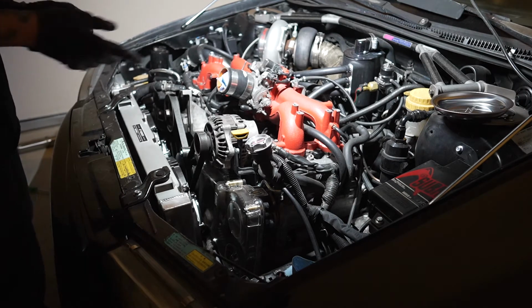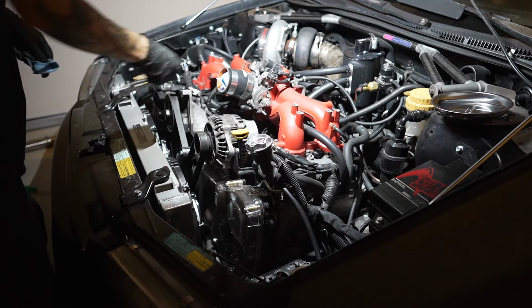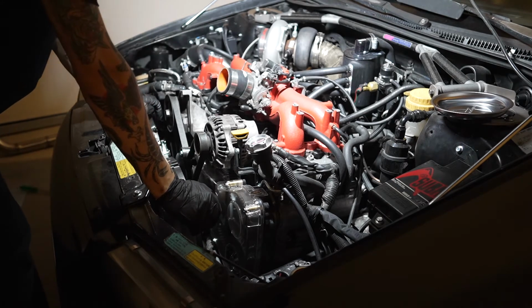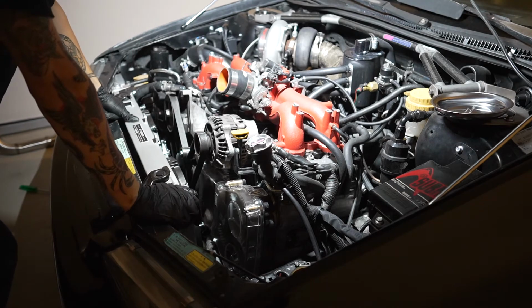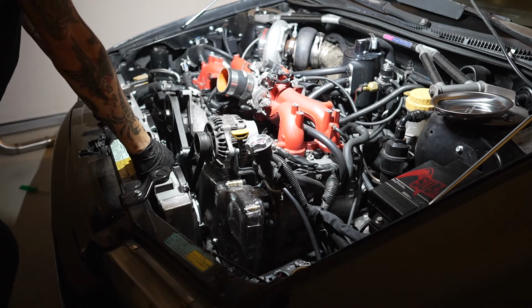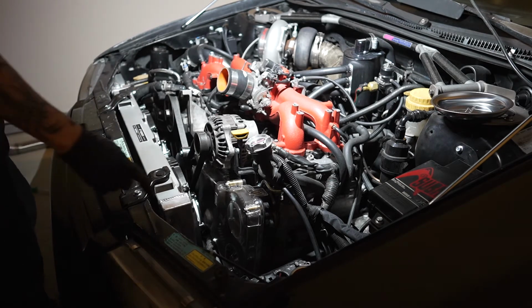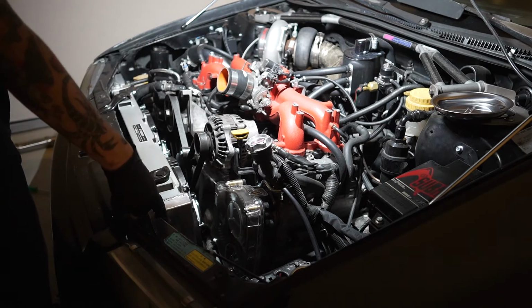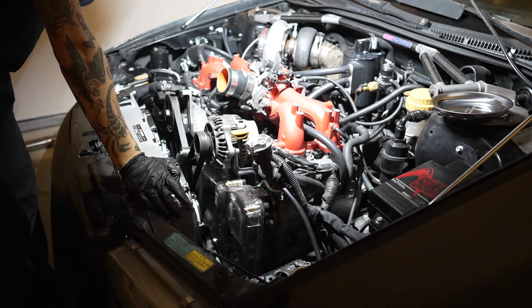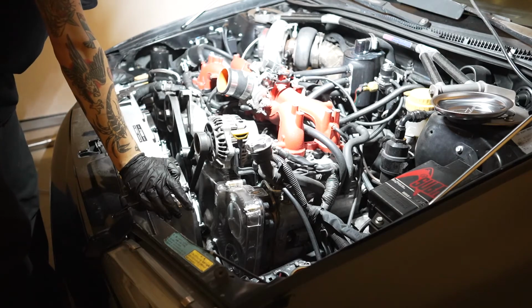So now I'm gonna get the front piping, pretty much reconnect that, and tie the lower hose, and then that should be it. I'm gonna figure out how I'm gonna clean up the wiring for the bottom end of this car. If this doesn't work and it continues wanting to overheat, the radiator is going to be next. It looks like I do have some clearance for at least maybe half an inch. This side I would have to cut a little bit, but I wouldn't mind cutting and sacrificing a little bit of the front rad frame to fit a bigger radiator. So yeah, that would be the next step. So hopefully this fixes it. Fingers crossed. I mean, it seems to be fitting pretty well, so we will see.